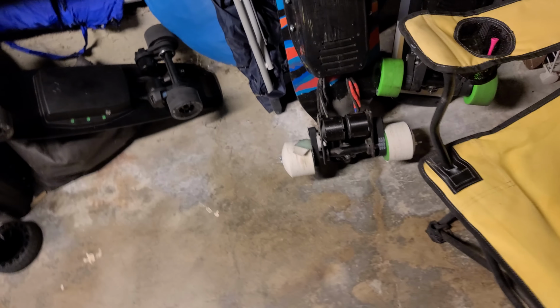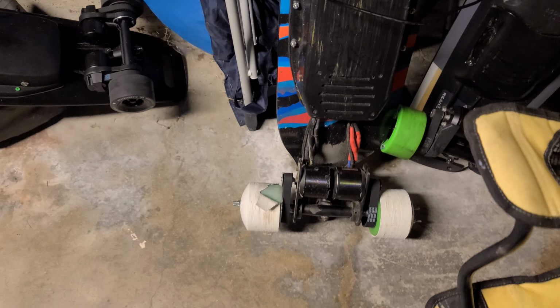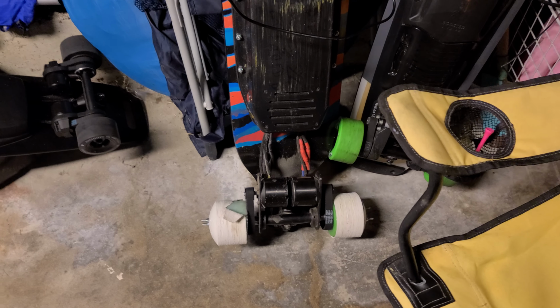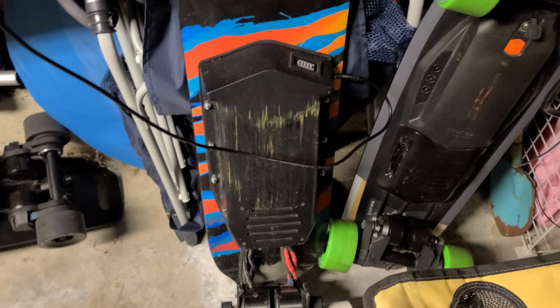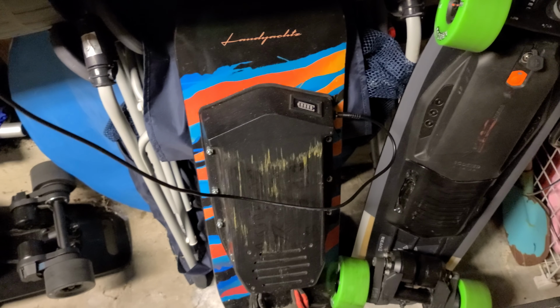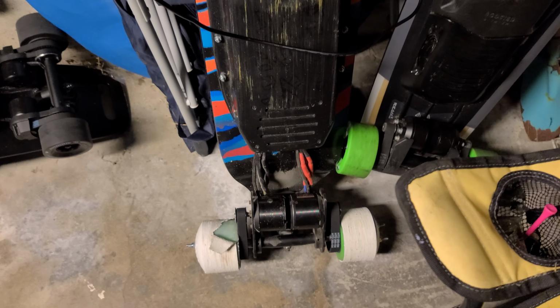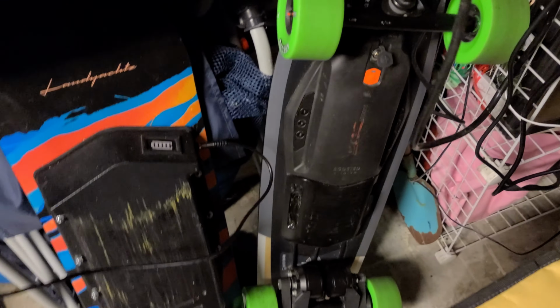So I think I covered all the boards. So MatMex Mini, this is a dual 6355 torque board motors. I changed the deck a bunch of times. 12S2P Samsung 40T batteries, Flipsky 4.20 plus, and right now I'm actually running MBS wheels. Those are just wheels, and that's my first Boosted Mini S.